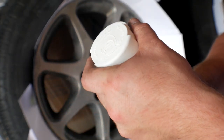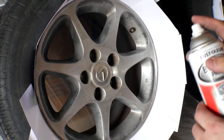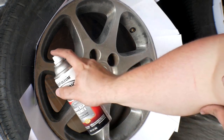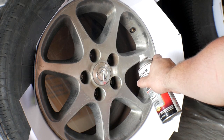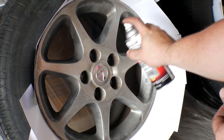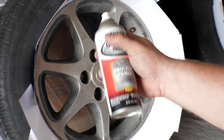Let's get to it. One important painting tip: never start and stop the spray on the paint itself, otherwise you'll get heavy spots. If I spray here and stop, then start here again, I've hit this area twice and the rest once. Always start your spray off to the side of a notecard and come back across — that way you get even coverage.